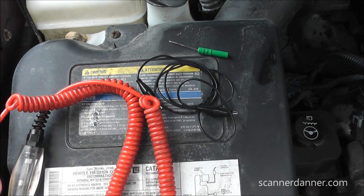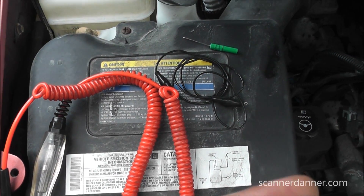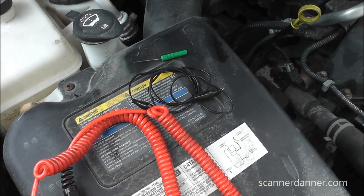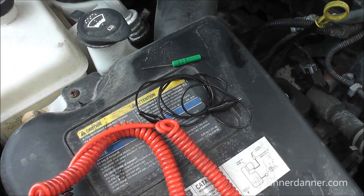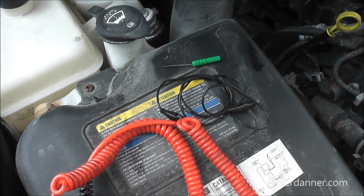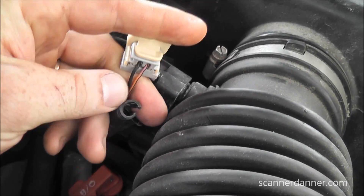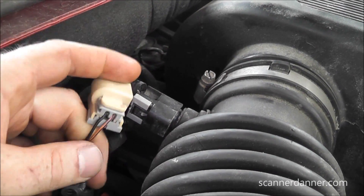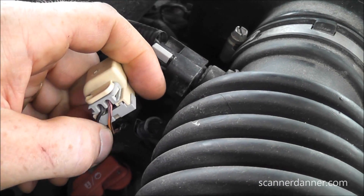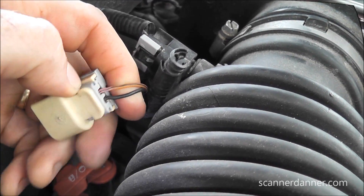I know I'm using an expensive scan tool, but any scan tool with bi-directional controls will get you as far as we are right now. If you don't have bi-directional controls you'll work harder - you'd have to find the relay and energize it manually, which means you need a wiring diagram. Time is money. We're going after this connector to determine how this solenoid functions. I don't have a diagram but I have wire colors - on a GM a black wire is typically a ground or control, and pink-black is typically a power feed, but we have to verify by checking the circuit.